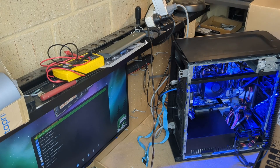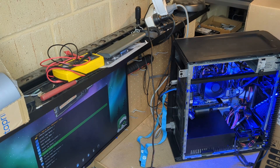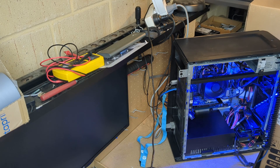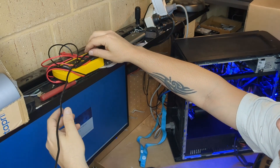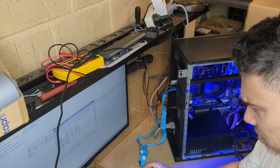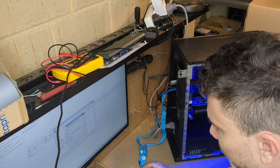I got it going with 16GB of RAM. I had a bit of a panic because it wouldn't boot up, but then I reset the BIOS and it came good. I've got a donor card in there because I want to flash Windows onto a flash drive. I'm using a USB drive with MediCat on it — I'll leave a link in the description, it's very useful for this sort of stuff. I've got MediCat loaded with Macrium Reflect, which is imaging software. There are a lot of partitions on this drive — I don't know if I should back it up or not. Let's live dangerously, shall we?